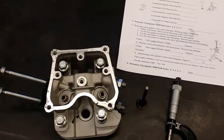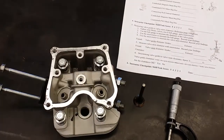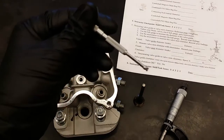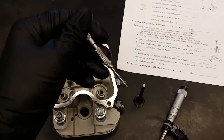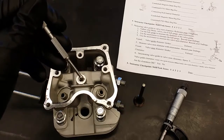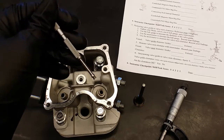Let's go ahead and measure some basic valve guide clearance on our cylinder heads today. To do this you're going to need your cylinder head, your valves — I've selected the exhaust valve for this example — a zero to one inch micrometer, and a small hole gauge. Due to the size of the valve stems and valve guides in our engine, we're going to need a size B, or the second smallest one in a set of four.